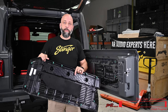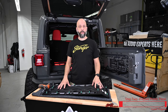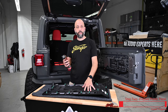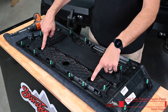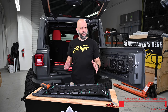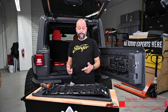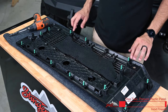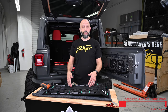Now that we have this panel removed, we can take it over to our workbench where we're gonna drill four holes. We're ready to take the included 13 millimeter drill bit and drill four holes in this panel. The top two are gonna go right down through the top holes where our trail rails mount, and the bottom two are gonna go down here in the bottom end of the plastic. You're watching our YouTube video, so you probably haven't looked at the install manual — now's a really good time to do that. Take out the install manual; there's a picture of the back of this panel showing the two top holes and the dimples where the two bottom holes are gonna go. Make sure you drill these in the proper location because they are gonna go through the plastic.